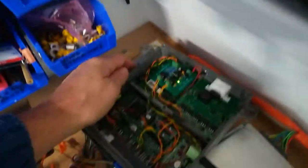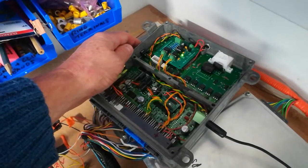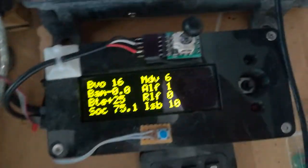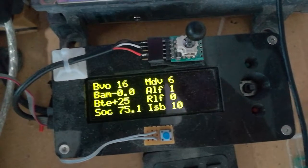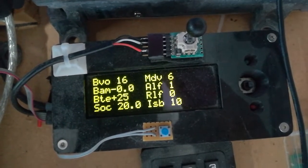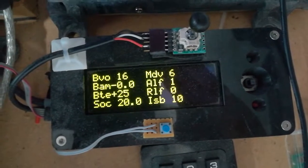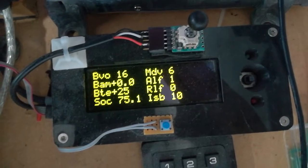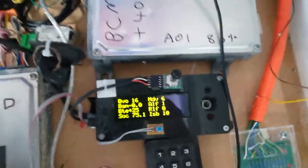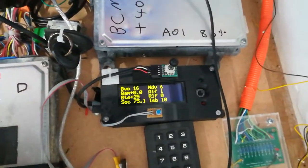The SOC mode switch lets you switch from 75% SOC fixed to the variable average voltage mode. Right now it's on the 75% setting, as you can see on the OBD. If I flick the switch it goes back to the variable mode, and because it's not connected to any HV it thinks the pack is empty, so the SOC shows 20%. Switching back to 75% returns it to that fixed value — that's the mode switch for PHEV users who want a fixed 75% state of charge.